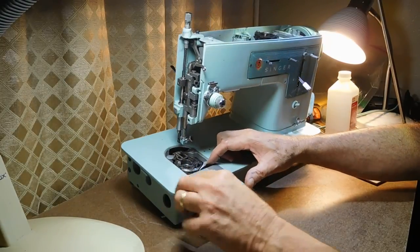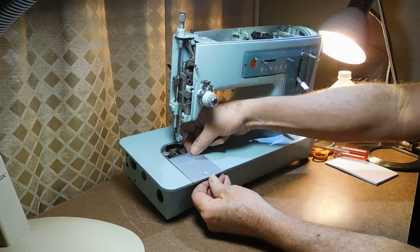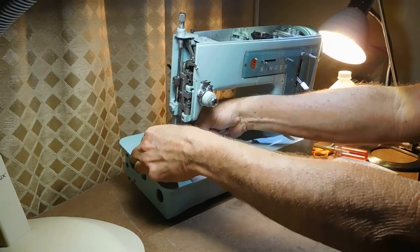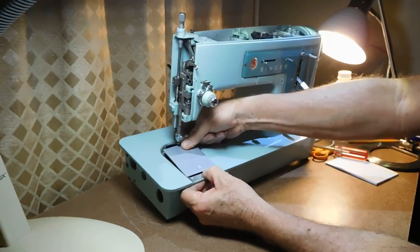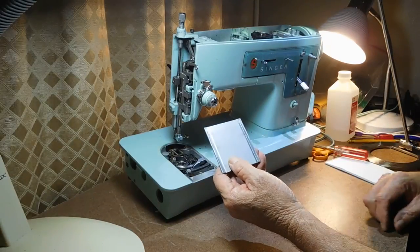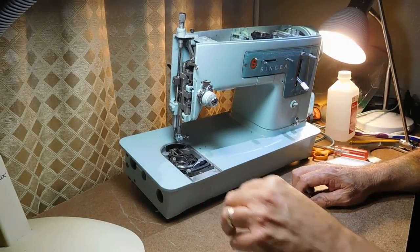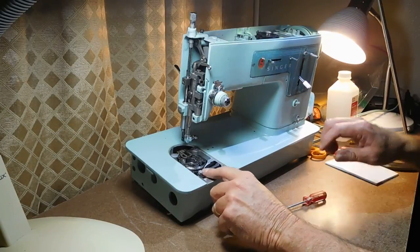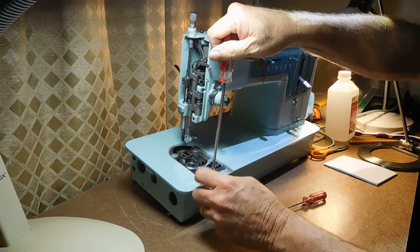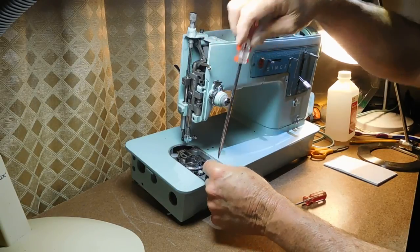I want to take this slide plate off. I know if I lift it up and slide it forward I should be able to get it off the spring — the spring is way up at the front on this one. Probably the slides are full of a lot of dirt and dust. I'll take the screw and the spring out because it needs to be cleaned, and it's probably going to need to be cleaned underneath it too. The spring is very springy and that's great.